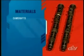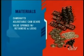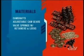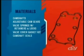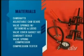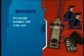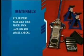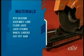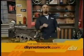Here's what you're going to need for today's project. Start off with a high-quality set of billet ground camshafts and a set of adjustable cam gears. Plus, a set of high-performance valve springs with retainers and locks. You'll want a valve cover gasket kit and fresh camshaft seals, plus a valve spring compressor and a compression tester. High-temp RTV silicone and assembly lube are also needed, along with a floor jack, jack stands, and wheel chocks to keep things safe. Plus, a cutoff saw and your standard shop tools to get it all done. You can get a complete list of materials and instructions by visiting our website at DIYnetwork.com.